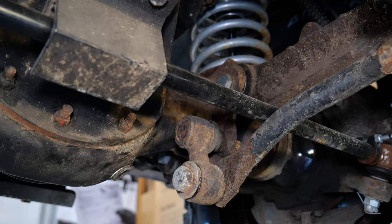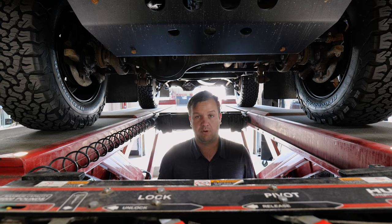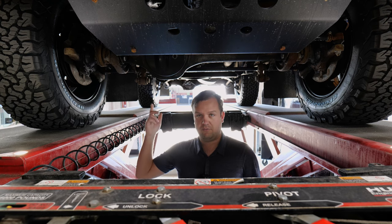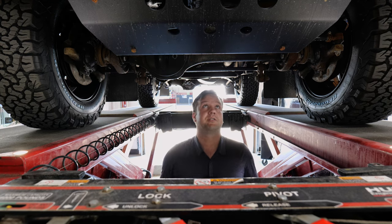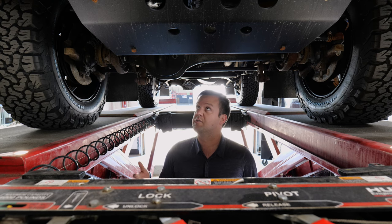But you want to make sure the suspension components are okay. They're super easy to see and visible because it's a fairly open car and it's quite high off the ground, so check for things like that. The shocks, I mean, all four shocks in this are replaced, as well as the steering stabilizer shocks. There's quite a few things you can see that let you know this car was well serviced.